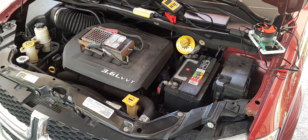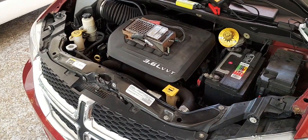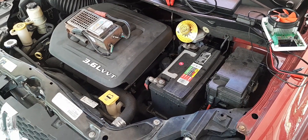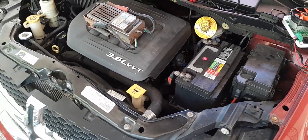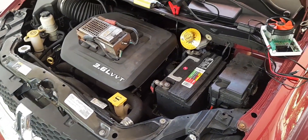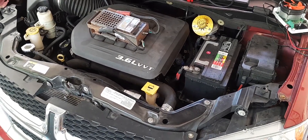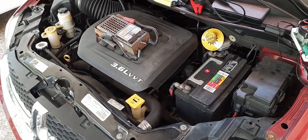At first I thought there was something wrong with my vehicle in particular. I checked the charging system to make sure it's charging good, and I checked for parasitic draws. It does take a while for my computers to completely shut down — about 12 to 15 minutes after I turn the key off, with all doors shut and everything left alone for all the modules to go to sleep. But after that, everything's good, so there's no crazy parasitic draws.